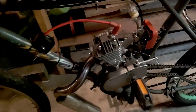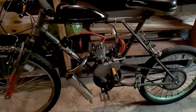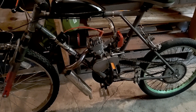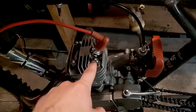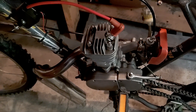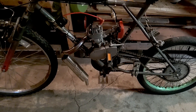That piston in there seized up and basically welded itself in there. Now we've got to figure out a way to get it apart. I think I'm going to pull the spark plug and put some PB Blaster down there and try to spin it over with the spark plug out so it doesn't make compression. And then maybe I can at least get it busted loose enough so I can pull that jug off.